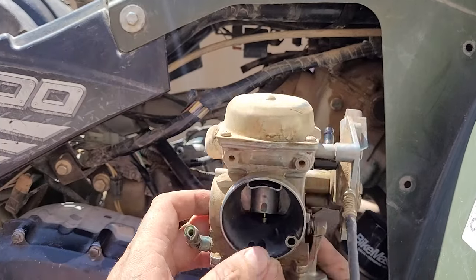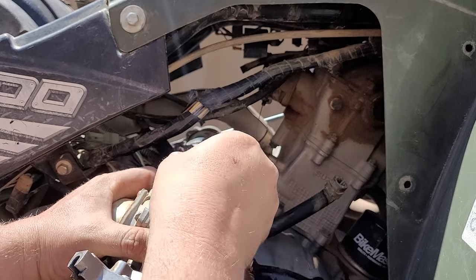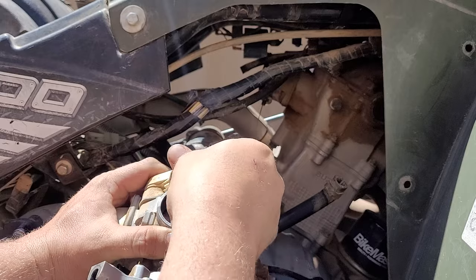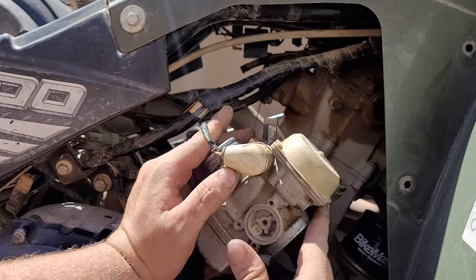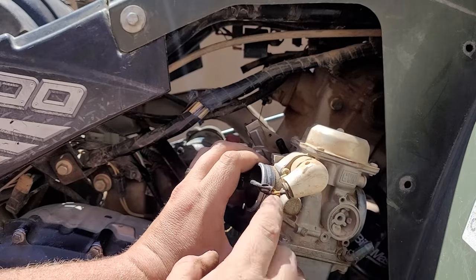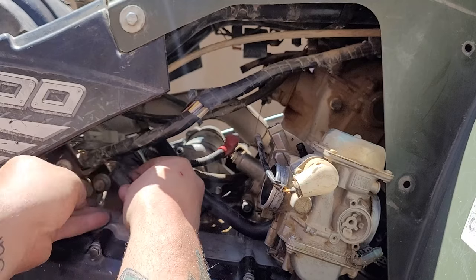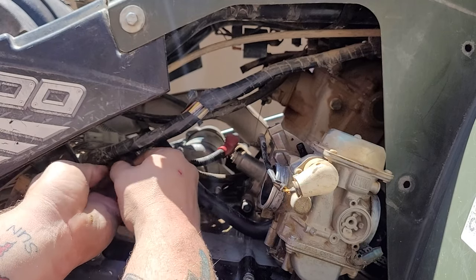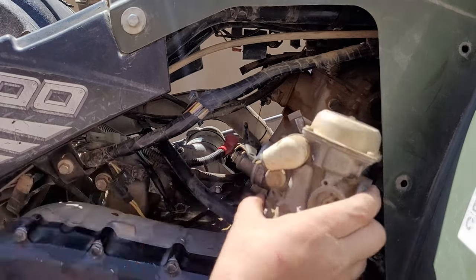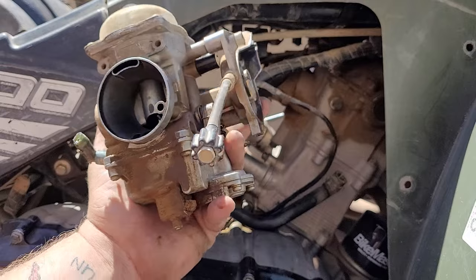And we have an electrical control component right here. Let's see if that should just remove. I think that's for the electric choke. And it looks like the key only has one Phillips right there. Actually, to be honest, I could just disconnect it right here and we could still get the carburetor out. You know, I normally don't get stuff this technical, but we get it out, we get it clean, we get it going. So let's take this inside and dismantle it.